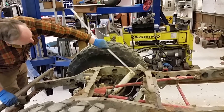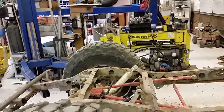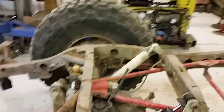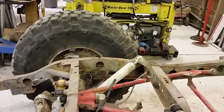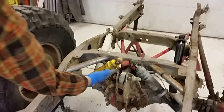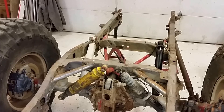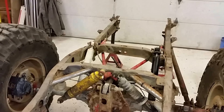We're about 5 inches. Look, we've got 3 inches of shock left. Now we're going to go all the way to the bottom. What you'll see in that last 4 or 5 inches of travel is the shocks rotating around their mounts — they're not doing anything. So you've got 5 inches of travel and an inch and a half of shock around the back. You want to shoot these two shocks here — they're rotating. Right where we needed shocks the most, we didn't have any.